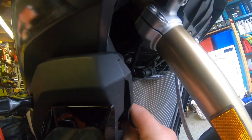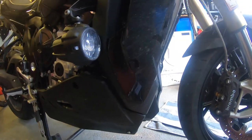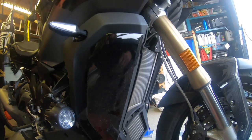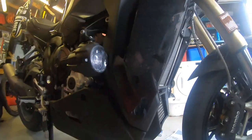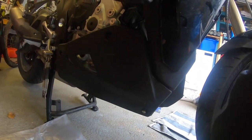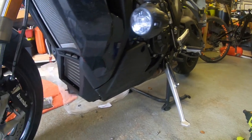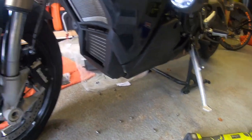So that's all the bolts and screws out for the shroud for the radiator — nice and free all the way around, and all the fairing on this side. I don't actually have to take the fairing off, just loosen it. The bolts are different sizes, so I've laid them out as they would come out. Opposite side, exactly the same. All the screws laid out so I know where they came from.